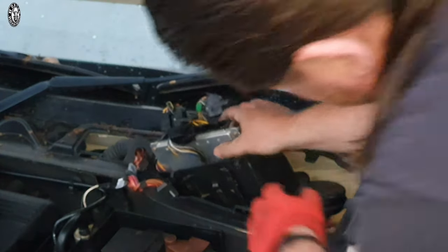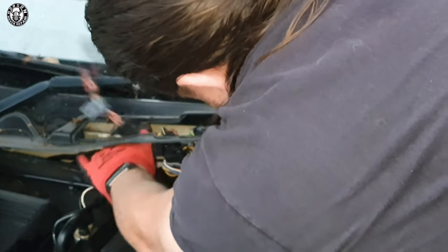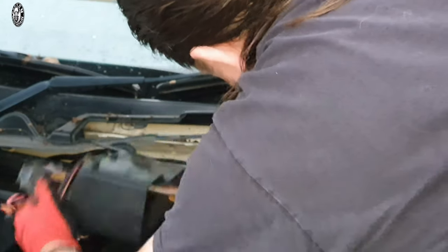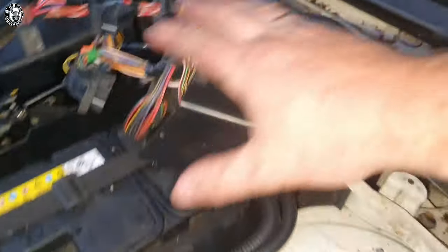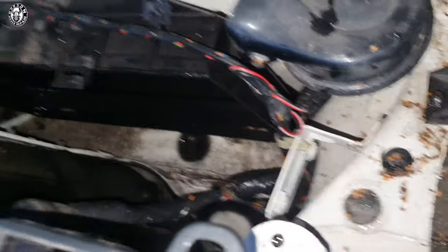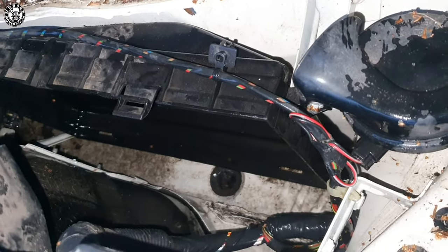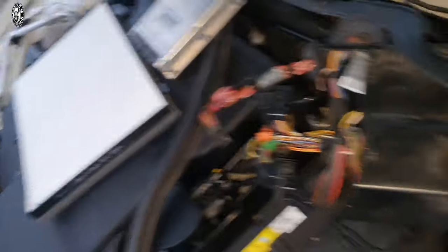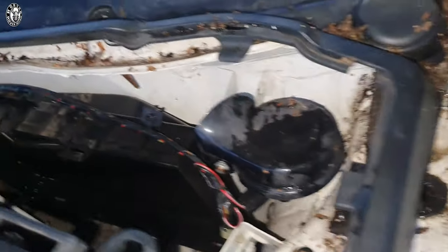Once that's safe and done, it gives you great room. As you can see, all the wiring is pulled to the side — just gives a little bit more freedom and you can see clearly down into the firewall area. I have already removed the filter and this is the middle plenum people talk about so much. As you can see it's flowing perfectly well. Now it's a case of popping the new filter back in. While we're at it I'm going to clean out any excess gunk in there as well, just for my own personal security.